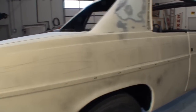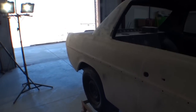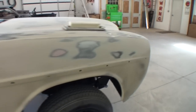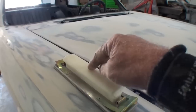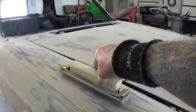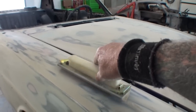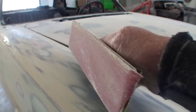If you look at the situation we have, you can see where I've already made marks of problems that have arisen on the vehicle. After priming it and looking at it with the light, I noticed there's a lot of waves going on in the top of these doors and that whole quarter panel right there. I am block sanding it, and what I'm using is a hard block. This is not a flexible block — it is a solid hand block and it is super flat.